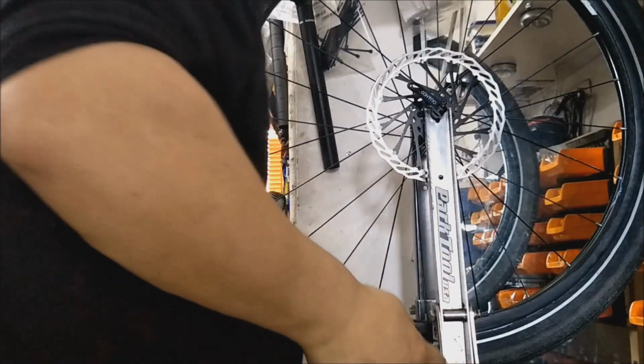Sometimes what can happen is the tyre doesn't have a lubricant. The rubber can be really rubbery and it gets jammed just under the bead, and you're up there at 60 psi, thinking, oh my god, if this goddamn thing pops, it's going to blast all over the place. I've had that happen, stupidly in my house, all over the ceiling, over the walls, and in my living room. Had to clean it all off. So I prefer to use a lubricant.